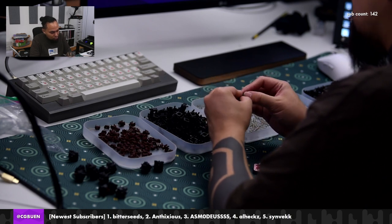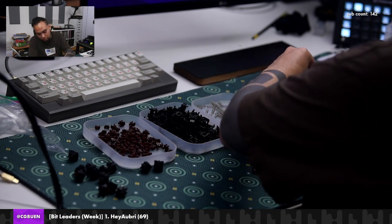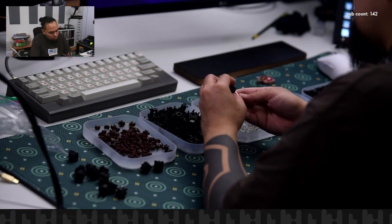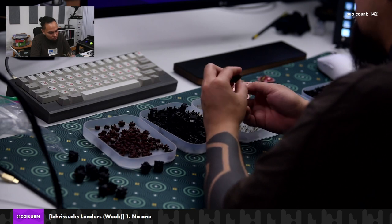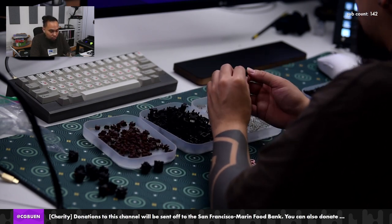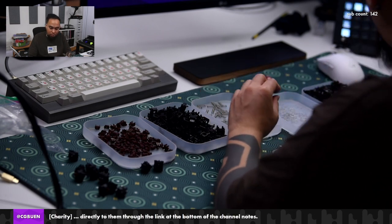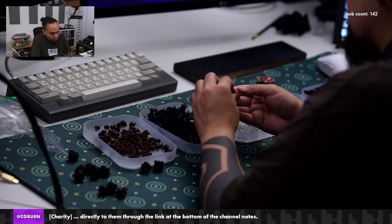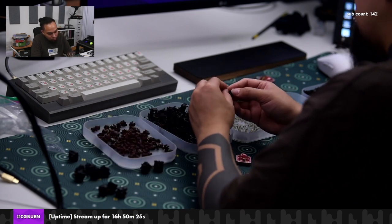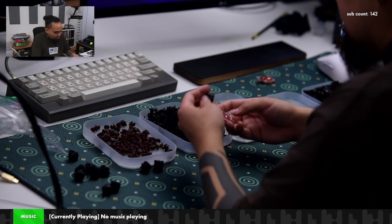They're a lot like scissor style switches, which is possibly what Mac style keyboards might be using. I'm not 100% sure. Those would probably be the most common ones, these low profile Choc switches and some different Cherry G84s, which I think are scissor. So there are some scissor switches, though I don't know if you'd call them super customizable by any stretch of the imagination when you look at the world of custom keyboards. There are a few more you could talk about, I suppose, things like Topre short throw, which is not something anyone ever really sees.